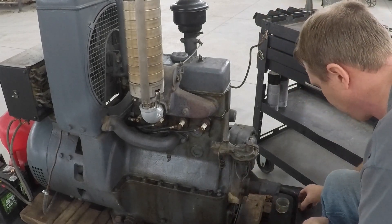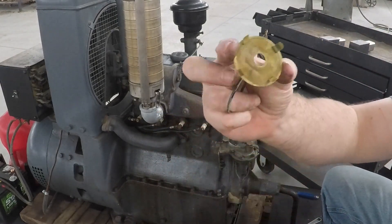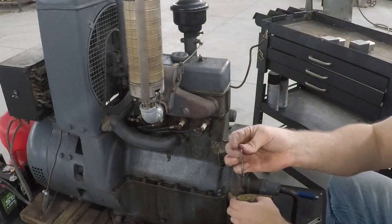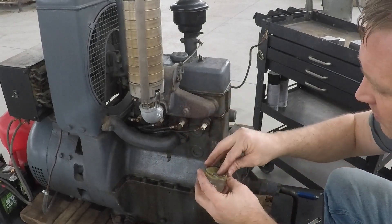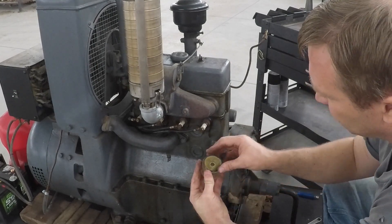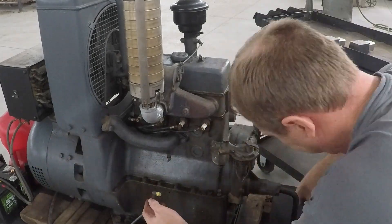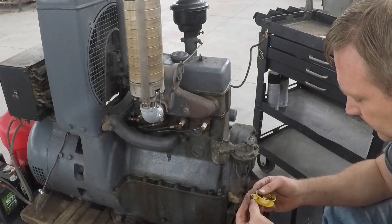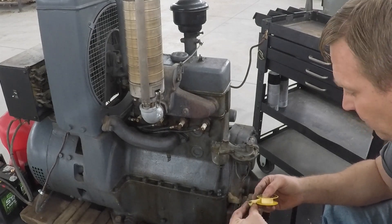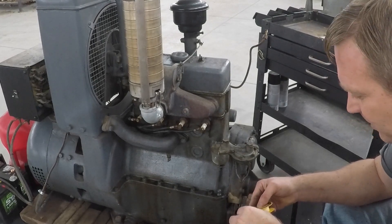Now we can put the sediment bowl back in. It's got a nice little screen here — you put the fingers down and they help it stay in there. If your gasket's shot, this is just a Buna-N O-ring that fits the same, just a little bit slightly smaller diameter than the bowl. For the inlet fitting, just putting some new thread tape on it. Make sure you use the yellow — that's for oil and gas. The white stuff will just dissolve; I've tried it just for fun, it doesn't work.